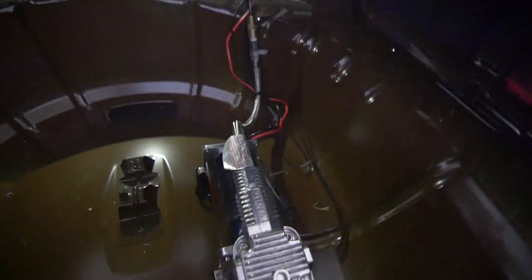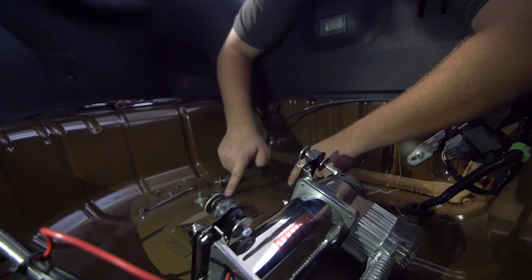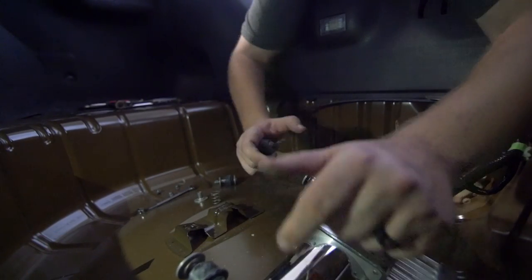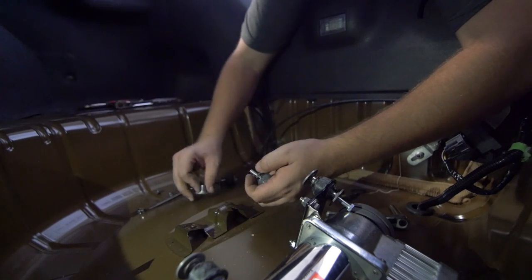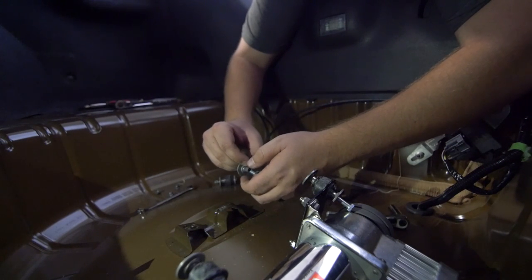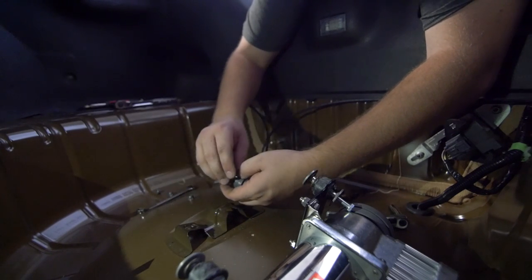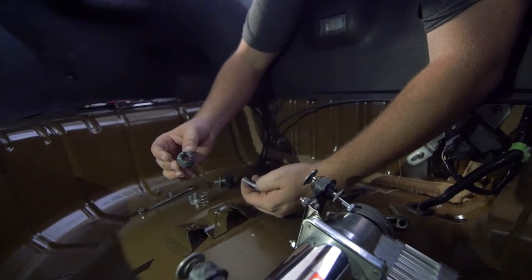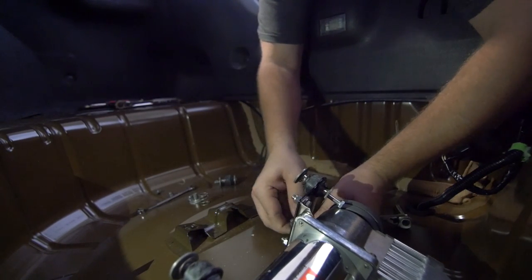So now let's put the rubber feet right there onto here. One thing I like to do if you're taking something apart, I don't know if you can see these right here, but let me move this out of the way. So when you take something apart and it has multiple pieces, what I like to do is set out the parts the way they came off. So this comes together like this, set the screw, sleeve, spring, bushing. This goes in, and then you can just reassemble the way you took it off.